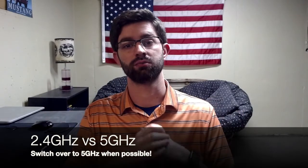You've heard me talk about the 2.4 and 5.0 gigahertz bandwidths in other videos, so you may already know this. Switch devices that can use 5 gigahertz from the 2.4 to the 5.0 gigahertz bandwidth if possible. The fewer devices that are on your 2.4 gigahertz bandwidth, the better. Especially since the 5.0 gigahertz has more bandwidth, but it has fewer devices that use it. And so you're going to get a better connection and typically a faster, more stable connection that way than you would on a 2.4 gigahertz network.